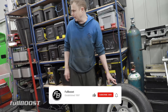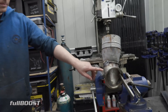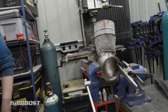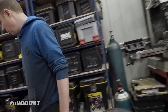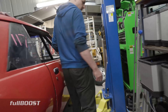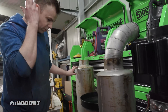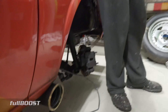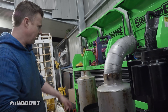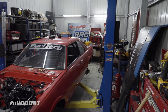I've got to do some clearance work in there to make sure they fit, but pretty much this is ready to go. So I'm making a bit of a backyard mechanic spec muffler system here. The other thing I did was modify the dump pipe with a V-band on the outside. So this V-band goes here and this will run off to a really dodgy brothers sort of exhaust system - to these massive mufflers. Two giant truck mufflers. I'll run it out of this V-band, it'll run down on the garage floor, we'll run the truck muffler in series - one into another, into another section of straight pipe, and then out of the garage. Hopefully that takes a lot of the noise out.